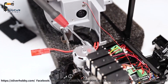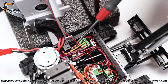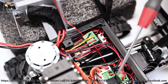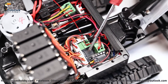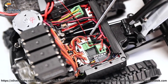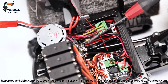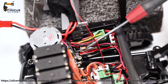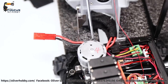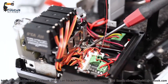And the left side here, that's the red power supply. It's going to the bottom of this power UBEC board. This side, that's the main board and the receiver. So all the servo is controlling from the main board. That's otherwise connections. So this one, that's the rotation motor gearbox. And go to the bottom, big rotation gear here. Now, that's the pump. And you can see here, all the nozzle connections to the wire block.